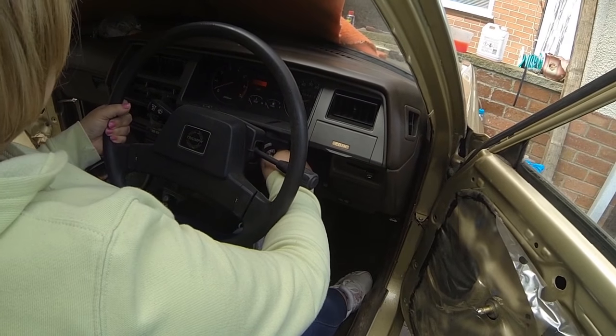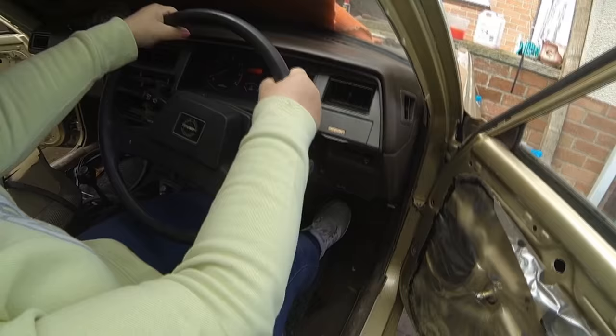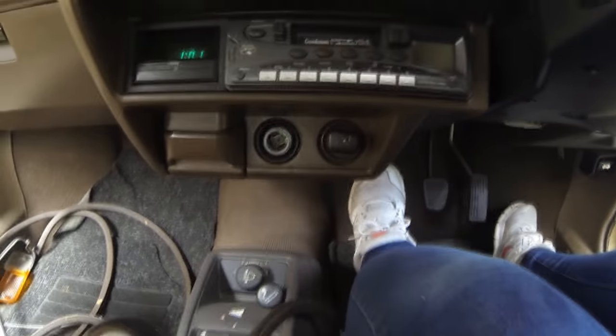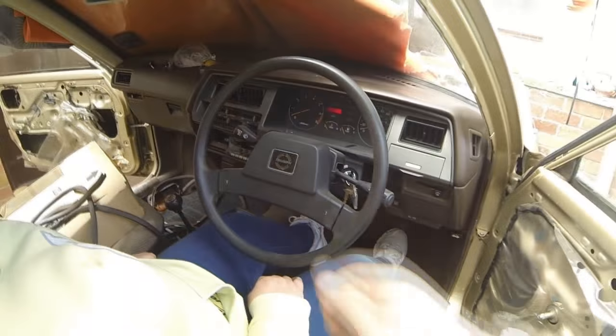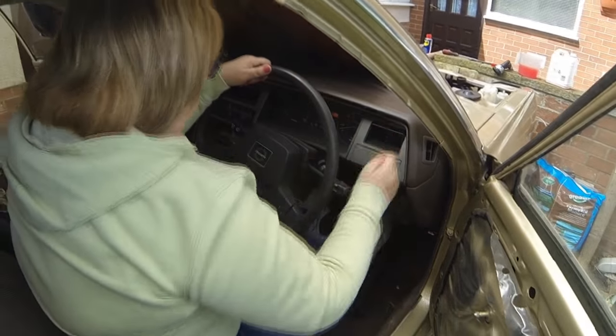Right. Now, you might want to put your foot on the throttle because we've got to fill the carbs up with petrol. Yeah, you've got a choke over there. Look, see the choke lever? I've never done a choke. Right, that's the choke lever down there. We want to pull the choke out for cold starting, you see. Now, if it revs high, you might slowly want to push the choke in, all right? But it shouldn't. Go on and try turning it over.